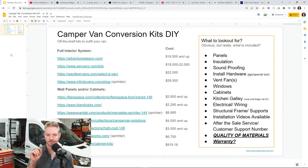Typically when you're building a van, you want all that power that the van's going to use in a separate system. So that'd be your leisure battery, I think is the technical term for it. Your car battery, the battery that is for starting the engine, you really don't want to use for any devices. The devices inside your van, you want to use on your secondary system as much as possible to not run down your main starter battery for your engine. So even though there may be a power box to supply it, it might be easier, one, troubleshooting-wise, but two, wire that to your big battery bank, like your lithium iron phosphate batteries. Yeah, so John, my question would be, what's your use for it? Let me know what that is.